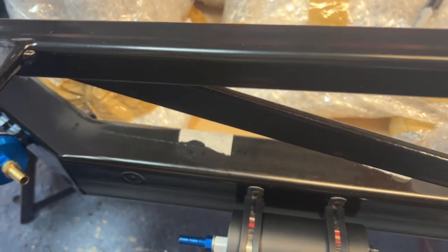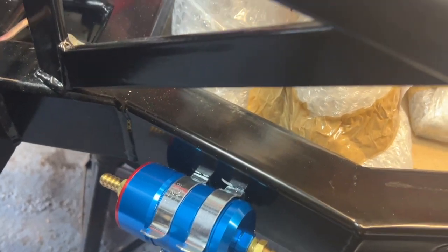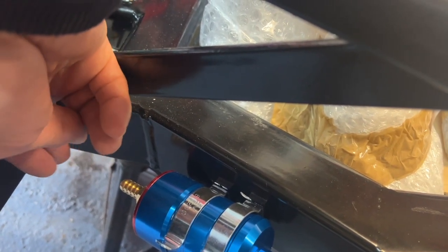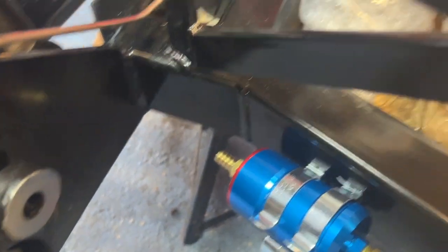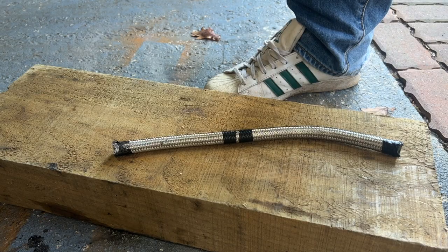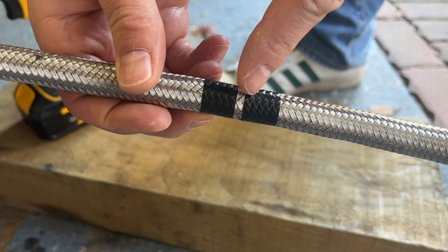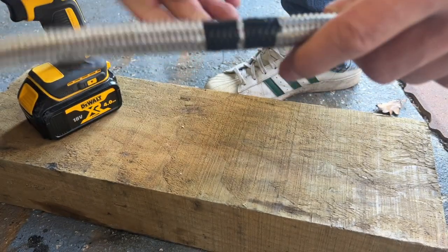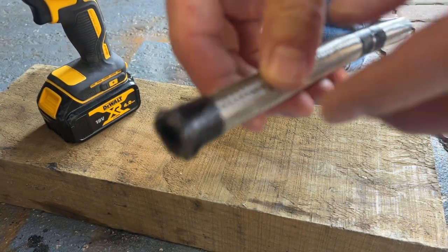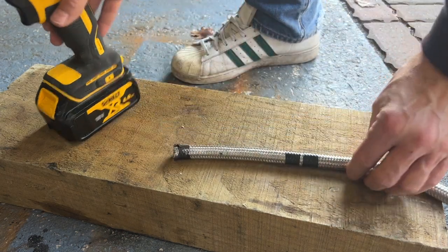Based on my previous build which cleared everything, I'm just a couple of inches back from the indentation on the frame. I've fitted the fuel filter at a slight angle so that the hose coming out the back toward the fuel tank is on a downward trajectory without too much of a kink as it goes underneath the diff. For cutting braided hose, I prefer to wrap masking tape really tightly around the cut point and then use a multi-tool — it vibrates so fast it goes through fairly cleanly without leaving too jagged a mess.